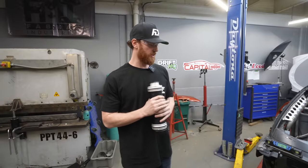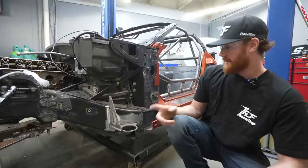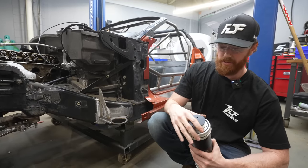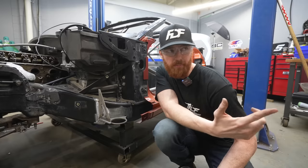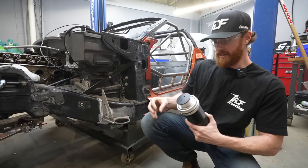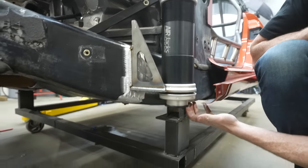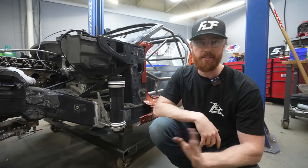So I'm putting on my air jacks on the front corners. I had to do a couple mods. The Corvette's ride height is approximately four and a half to five inches from this frame rail to the ground. When I had this mounted under the frame rail, it would have put this shoe like three and a half, four inches above the ground — not going to work. So I chopped it to fit the frame rail. I printed off a template from my computer, created a plane and made it perfect, so I could just trace that and cut it. So basically now this goes on here like that, and that tightens up and you've got your air jack in this corner. This is just above the frame rail, so this won't be the lowest point of the car. That is important for ground clearance, catching on things and all that sort of stuff.